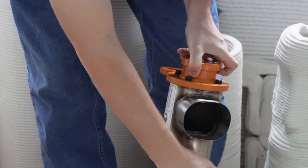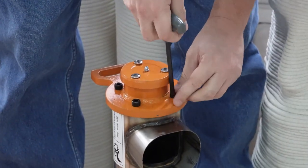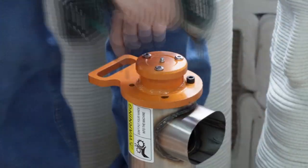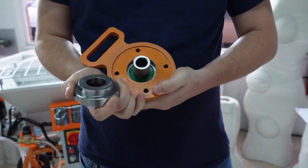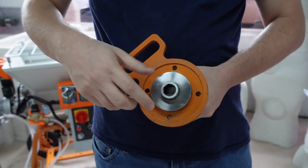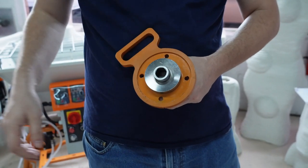You can put them back into place, or if you are having trouble doing so, you can open the end of the mixing chamber. You will need a 6mm hex bit to undo the four securing screws. Here is a close-up of the bearing carrier and the blade stabilizer, and here is what they look like separated. If yours are currently not in place, insert the blade stabilizer first, then insert the bearing carrier. If you are having trouble doing so, slightly rotate the bearing carrier when inserting it.